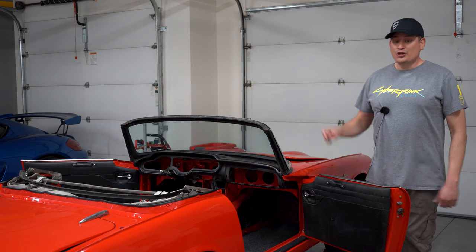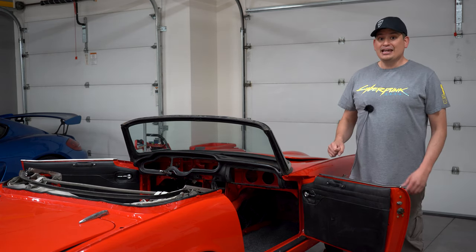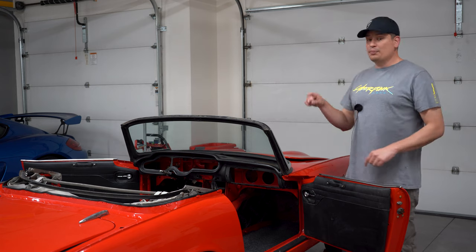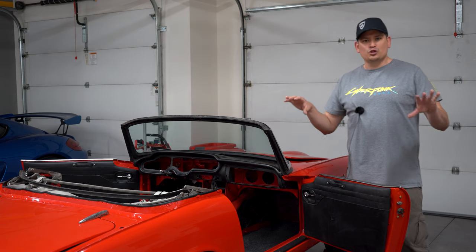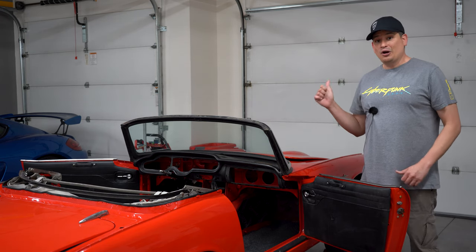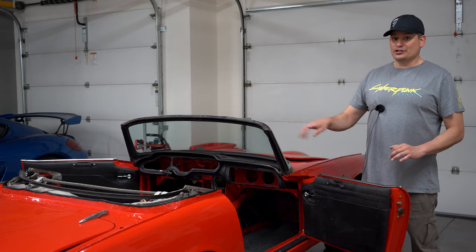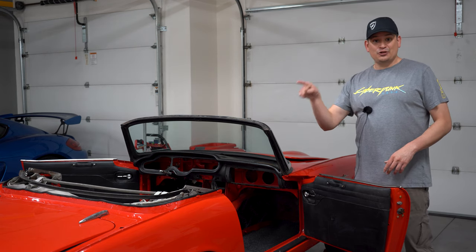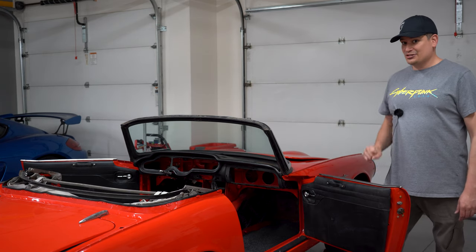So what's coming up next? Those trim pieces we dropped off with Ryan at Pro Powder Coating here in Grand Junction — he sent them to one of his buddies to get them straightened out. When they come back we'll put them on; we already polished the chrome so they look really good. Also the long aluminum trim piece for the gauge cluster is getting Cerakoted — it's a thinner coating process used for tighter tolerances, so we get to keep our lettering without having to repaint it. Once that's done, we'll put the polished gauge lenses in and put everything back together, and it's going to look really, really nice.